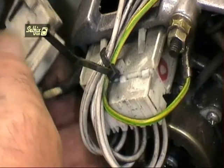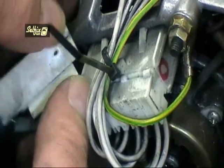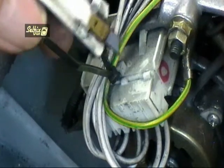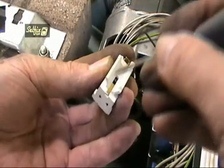There are a number of ways to achieve this. You could use an angled tip pair of pliers, or a pair of motor brush removal pliers like the ones I am using. Or you could just lever the tag in with a screwdriver and pull the brush out, although this last method does work it is a bit more time consuming and not as easy as the first two options.